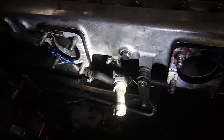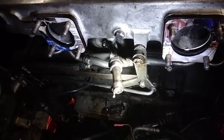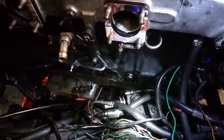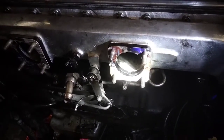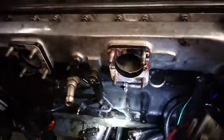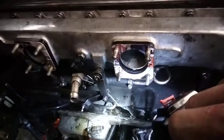I'm hoping that once we put this back together it'll be good enough that I can go for a drive and show you that. The next step is to put the power steering pump back together, pray it doesn't leak, and fill it up. I'll have to cut another gasket for the block side there — I actually did that with my intake manifold gaskets the other day at work, it's not hard. I'll put a gasket together, go down to Super Cheap, buy some goop, put it together again, and cross my fingers to see what happens.